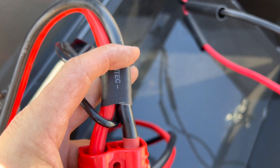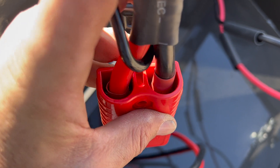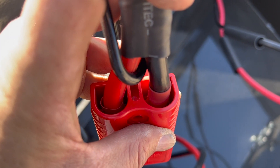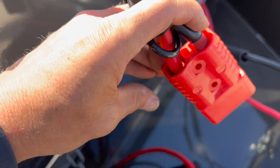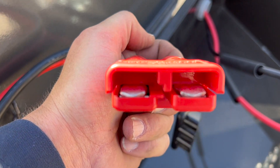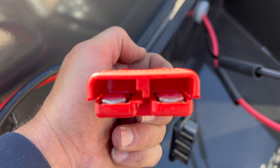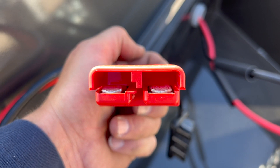Make sure that when you do your crimping, you can see how these wires go in. If you crimp them the wrong way they're not going to fit, because it's possibly going to flatten out and you're going to crack the connector — I know because that's what I did. Glad I had an extra one. But that's what they should look like on the inside. Give me about 10 more minutes to get this all plugged in and hooked up, and I'll show you what it looks like and power the winch up.